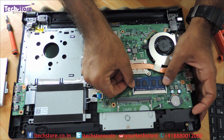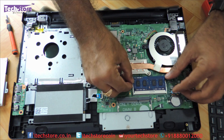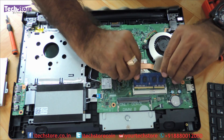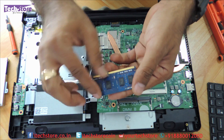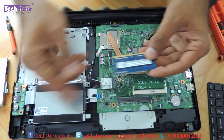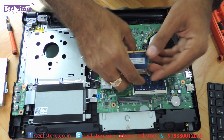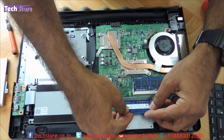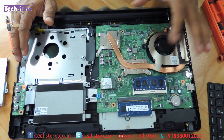For replacing the RAM, use your two thumbs on the two notches and the RAM will give away. You need to buy a DDR3 low voltage memory at 1600 MHz — it's a DDR3 4GB stick that we are upgrading with. The laptop already has 4GB, so we will put another 4GB onto it, and the RAM gets upgraded to 8GB.